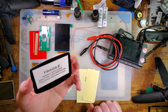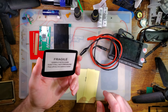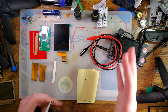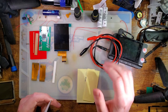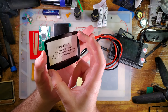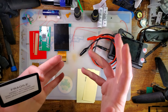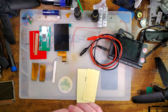Also got a lens. This is probably OEM sized because this is a little bit smaller of an LCD compared to the older backlight kits that use the 9380 LCD. This is a 3.0-inch diagonal, whereas the stock Game Boy Advance is about 2.9-ish, depending on how you measure it. If you're measuring the LCD itself versus the lens and so on, because it's offset, it's complicated. I don't want to get into it. The 9380 ones were 3.2 inches diagonally. However, they're noticeably bigger. So yeah, probably an OEM lens.